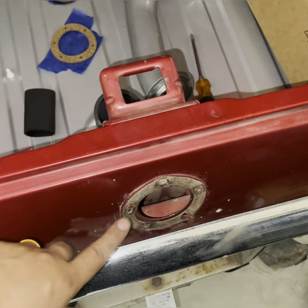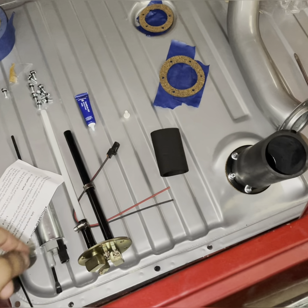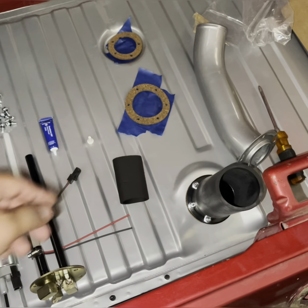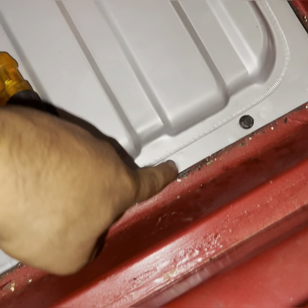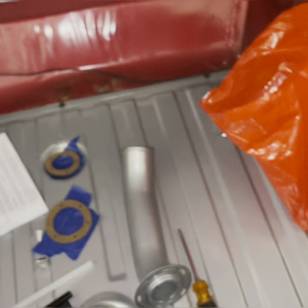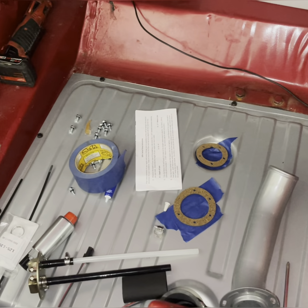I got the screws mounted in here, the cork gasket installed, and I installed these screws using blue Loctite, tightened as tight as I could get with the screwdriver, then slipped over this rubber cup. I taped up all the other holes so screws wouldn't fall in. I do have a correction: this gasket does not go here, it goes in that one, and this one goes in this one. If you need another gasket you'll have to buy it from CJ Pony or reuse it — this one's not torn, it's just flat. Next I'm going to put the screws back in around the side since they're dry now.